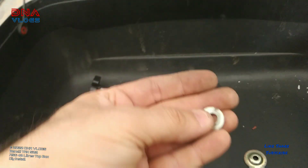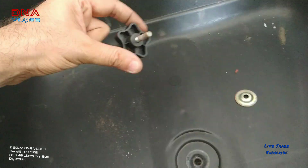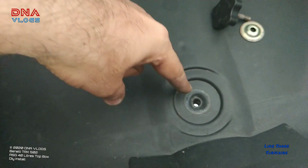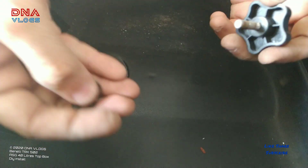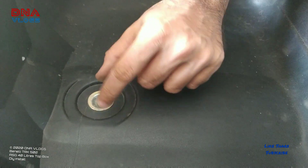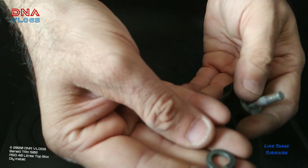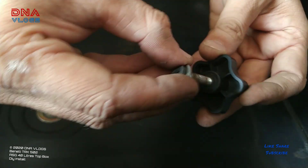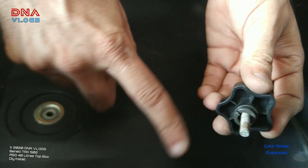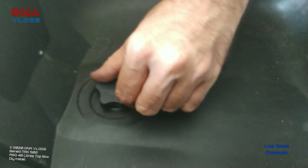What I wanted to show you is that you add additional washers. One will be a spring washer — we want to create tension so the bolt doesn't loosen automatically, because this mechanism has no lock nut down there. A regular washer goes at the very bottom to protect the plastic, and your spring washer goes in between the two metal parts. The spring washer should not be directly on the plastic side as it will tear it off. So let it be in between the two metal surfaces, and then just tighten everything.